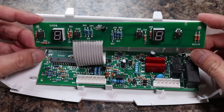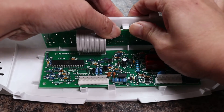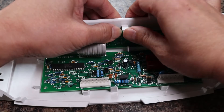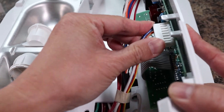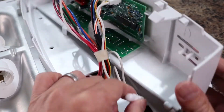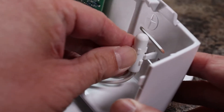The upper part needs to be flipped over so that the digital display faces the cutouts. When it's all aligned, snap this part in. Now reconnect the wiring harness — don't worry, you can't mess this up because they're different sizes. Finally, don't forget to reattach the sensor.